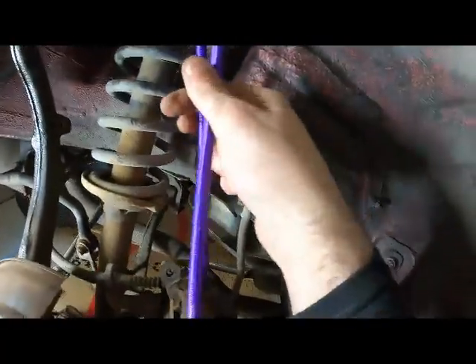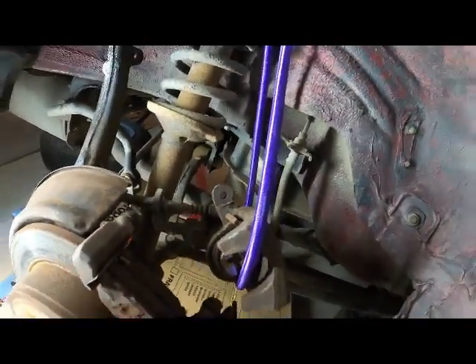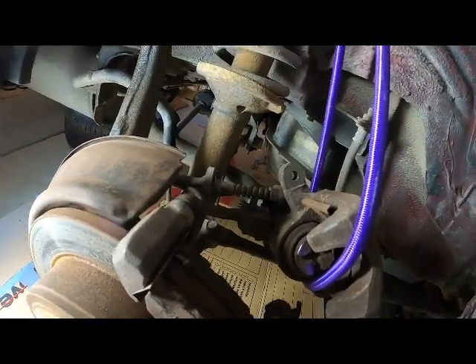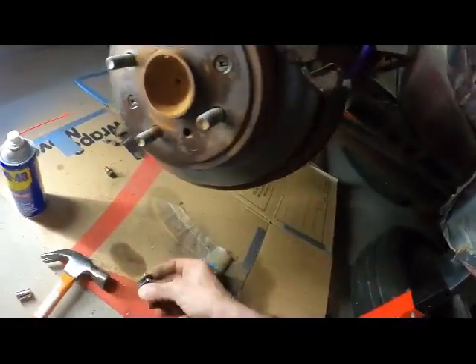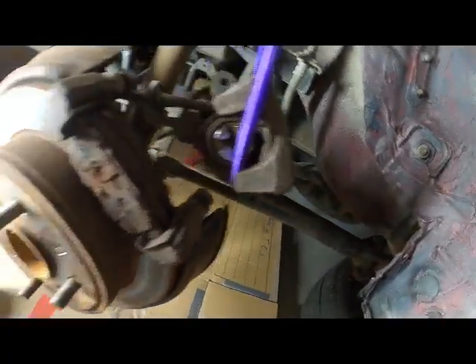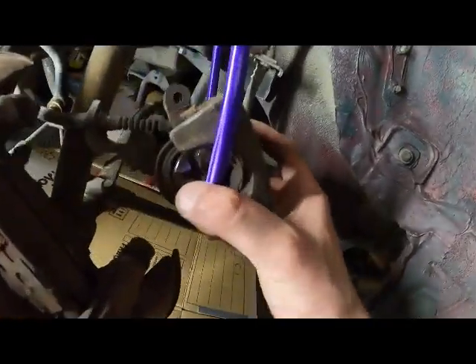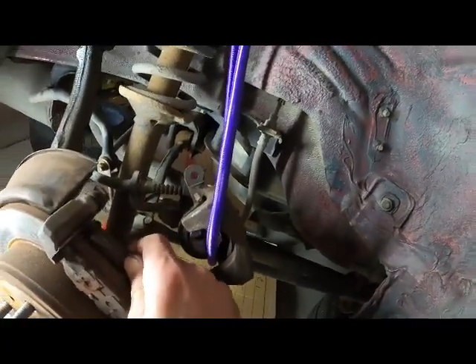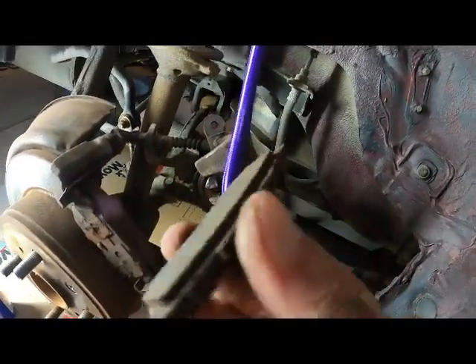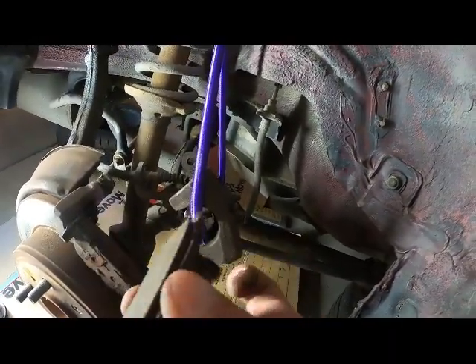We're making progress — this is the brake caliper, strapped over here because I don't want to put pressure on the brake lines. This is the emergency brake line — you need to put it down, don't engage the handbrake, otherwise you won't be able to remove the rotor. I learned that the hard way. Two bolts, size 12 mil — once you get them out you're done. The cover is size 10. Here's the caliper, the other piece, and the brake pads. Everything's a bit stuck but the brakes aren't bad — I still have enough pad.